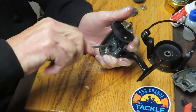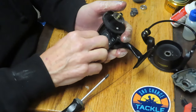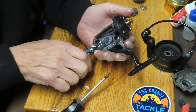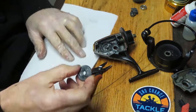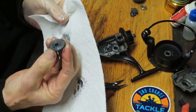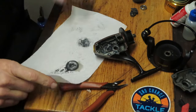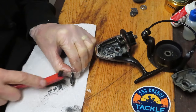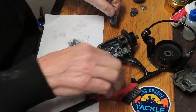There are times when I've worked on a reel and couldn't figure out the problem, and it turned out to be a warped gear. Nothing should escape you during examination — don't assume. We're going to take out the oscillation gear. Same thing — there's muddy grease on it, so clean the back, use some penetrating oil on the face, wipe that down, and take the hard brush through the teeth. I combine steps here because I'm examining the teeth as I'm cleaning them.